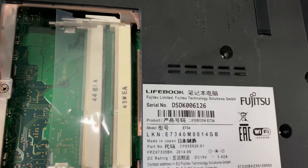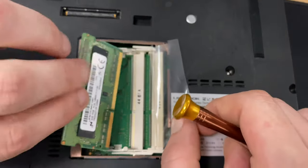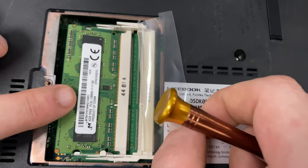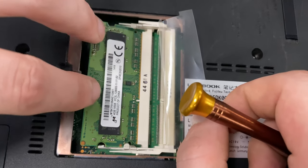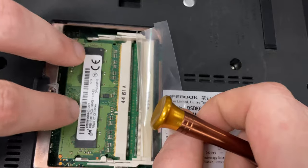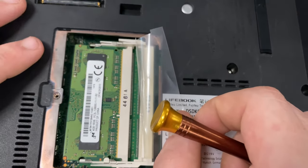You will not be removing your RAM since you'll be upgrading, but take your new RAM stick and slowly guide it into the holes. You'll notice it'll be jumping up and down a little bit, which is normal. Then slowly push down at each corner until you hear a click on each side, and you'll notice it is rock-solid when you're done.